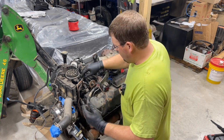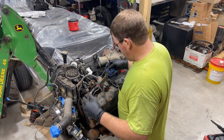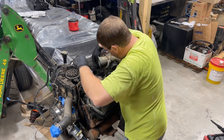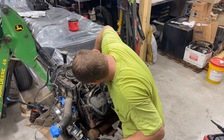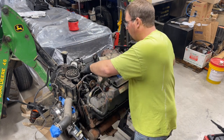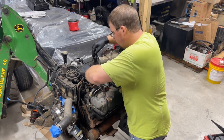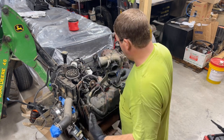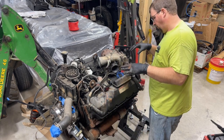That's your upper intake there. And like I said, this is a Super Duty, so you have a couple extra things. This is the owner's wiring that he added to do the custom exhaust brake with the butterfly valve that's factory on these — we're actually going to be deleting that, so that won't be needed any longer. Here is the old intake heater. We've got to get all this unplugged and undone so we can remove this wiring harness. But first, we're going to go ahead and get this turbo off of here because it really needs to come off so I can get it rebuilt.